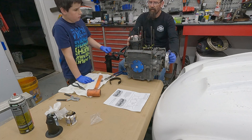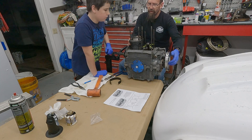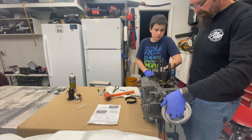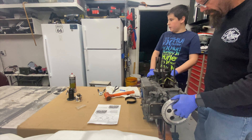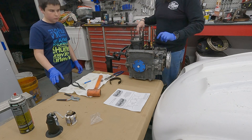Number three, it's done buddy. Boom. Does it spin? It sure looks like it. That looks good — affirmative buddy. A nice light coat of oil I can see on those cylinder walls when we're running them up and down — that's beautiful. Boom. Now I just need to do that three more times. All right, let's do this side — number four.